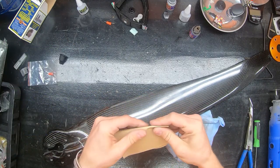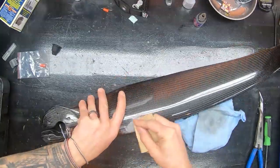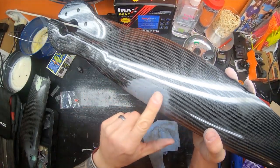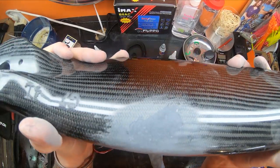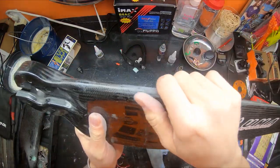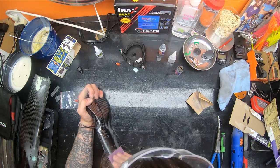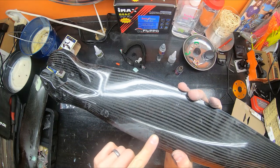Using a sanding block to get it as close to polished as possible. This is also a good point to tape off whatever you don't want to get ruined. I'm really happy with that — it's almost perfectly level. I don't know how well the GoPro is showing it, but you can kind of see where the Q-Bond is and it's almost perfectly blended. It'll be perfect once I wet sand it. Even after just a few seconds of wet sanding you can already see how much better it looks — it is perfectly smooth.